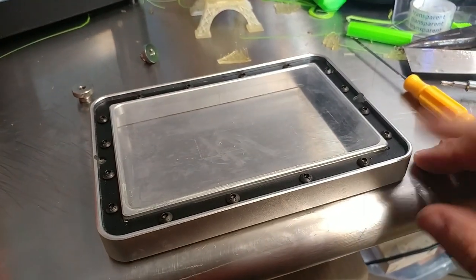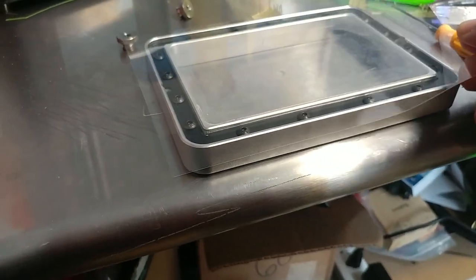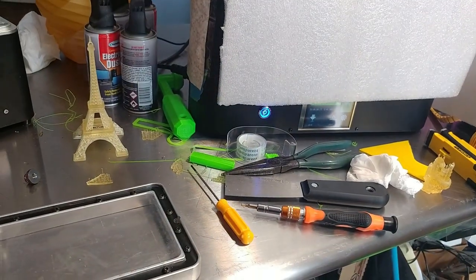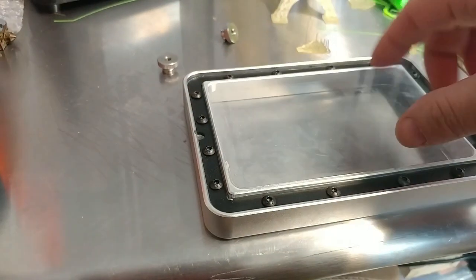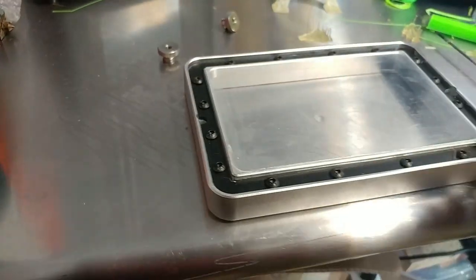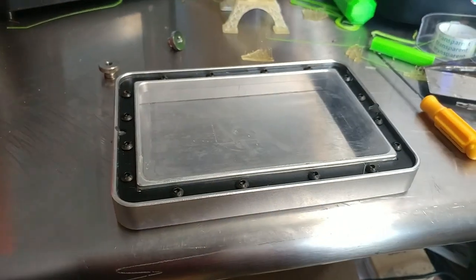So first things first, this is actually just a sheet of plastic. So if you go on Amazon, link below, you can get sheets of Wanhao D7 FEP, and it's the right size for this. So the way this will work is this sheet has to go on here. So you take out all these bolts, and you pop this out, and this sheet just sits on there. You lay the new sheet on, you lay the bracket back on, you poke a couple of holes through it, put the screws in, make sure it's straight, a couple more holes, a couple more screws, and go from there to make sure you get a nice drum finish with no wrinkles.